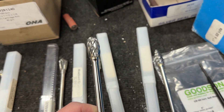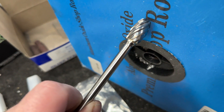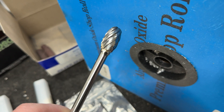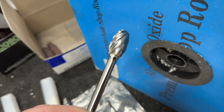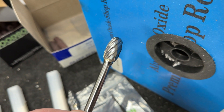This is the one that probably gets used the most for porting heads — this is a half-inch egg. It works very well. This is for aluminum; I don't port cast iron, but when I did I used the exact same burr and it just wore out quicker.